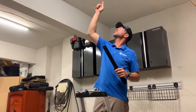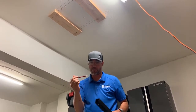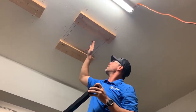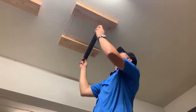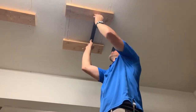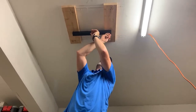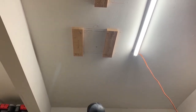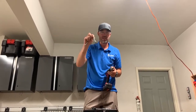We've mounted our 2x6s on the ceiling on the studs. I need to measure the spot where the power bar is going to hang the power unit. I'm going to grab a pencil and hold this up on the ceiling, lining the power bar up with the X I put for the rear lifting point. I'll mark those spots, then drill with a 15/64 bit — that will be the pre-drill hole for the 4-inch lag screws.